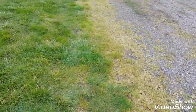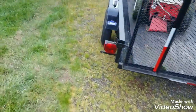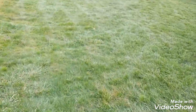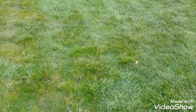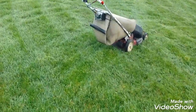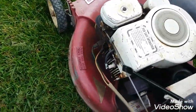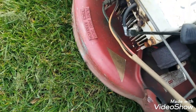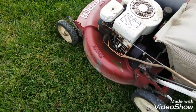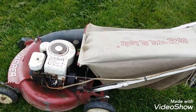So in both positions it revs the engine. It slows down in the middle and it revs both in the starter choke position and in the off position. We'll have to dig into that a little further. But hey, we got the free lawnmower working. Smokes a little. Something leaked on it. Well, what the heck? It's a free Snapper.